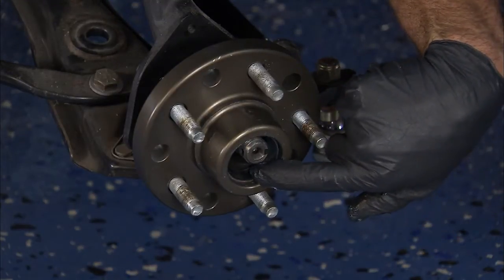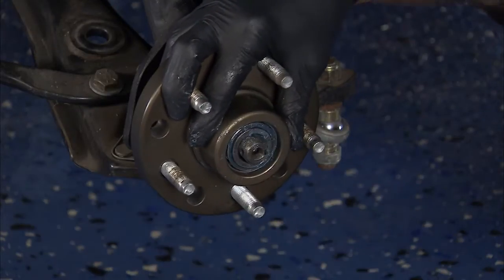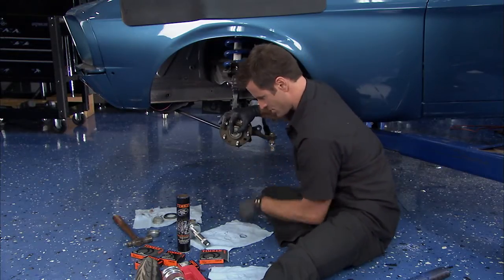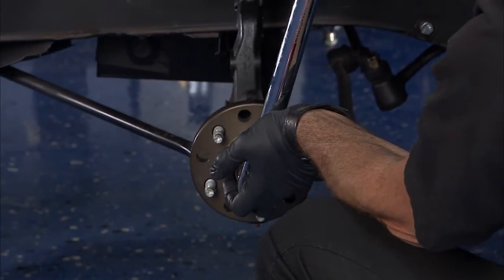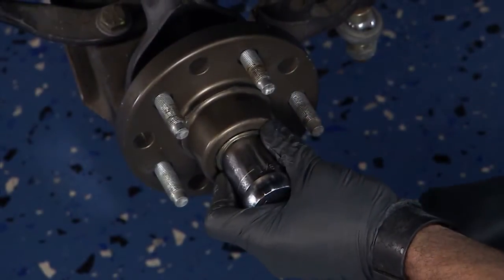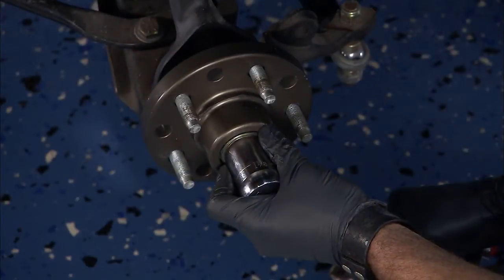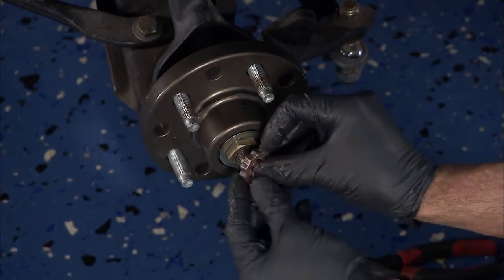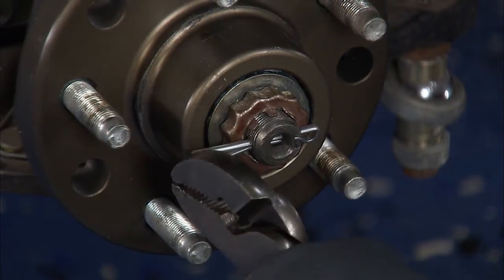You can see our little tapered seat in here. Put your bearing in. Now there's a washer, and here's the nut. After you torque it down to 50 pounds, back it out one turn, then torque back down to 10 pounds. Now back it out a quarter turn. Put your lock nut on. Last thing to do, go ahead and bend our cotter pin in. Get that solid.